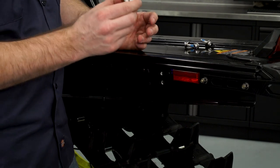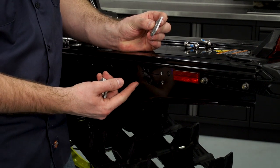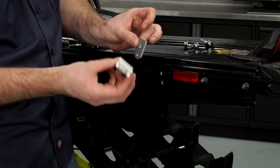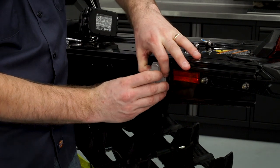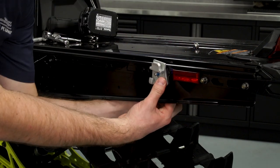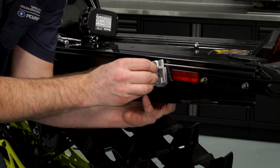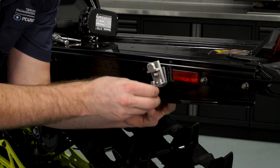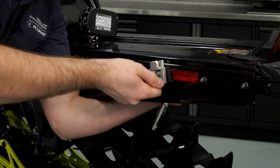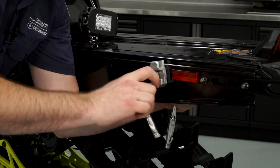With the holes drilled, we'll go ahead and install the mounting bracket. You'll note that there's a spacer that comes with the bracket. If you're using the extreme duty rear bumper, you do not need to install this spacer. In our case, we have the stock bumper, so we're going to put the spacer and then the bracket up to the machine. I'll feed the Torx bolts through from the back side of the tunnel, and with those in position we can install the two 10-millimeter nylock nuts included in the kit. We'll snug down these fasteners, but we don't want to tighten them completely — we'll finish tightening them when we do the final alignment and have the front bracket installed as well.